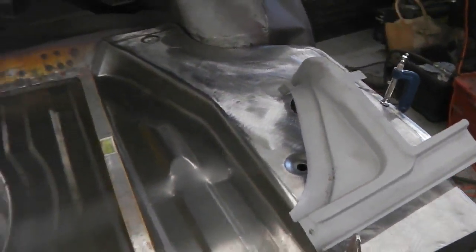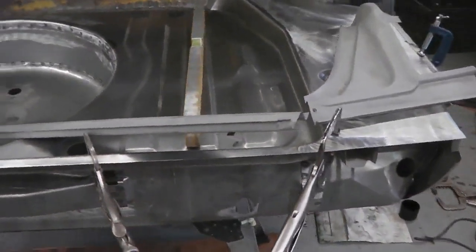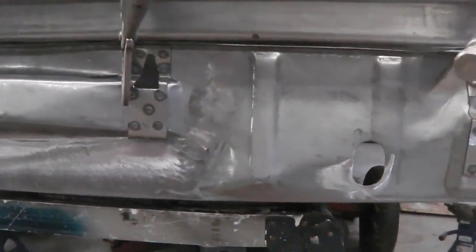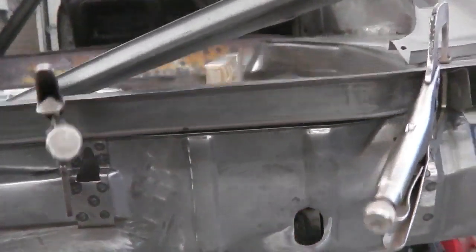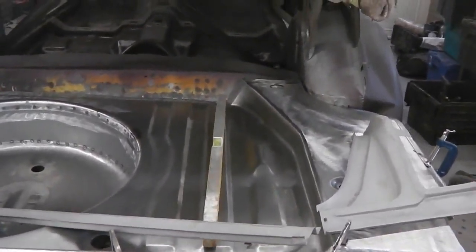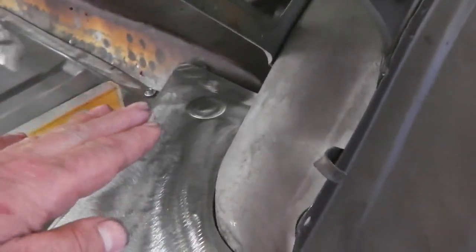And I'm thinking, somehow, with my chassis legs, something's gone wrong and they're pointing downwards. And when it comes to the welding time, I'll just pull them, bend them back up so that they're straight on the spirit level. And I thought, there's no way I can do it. They actually fit snugly in, and then the plug welded in, and they don't want to bend up.